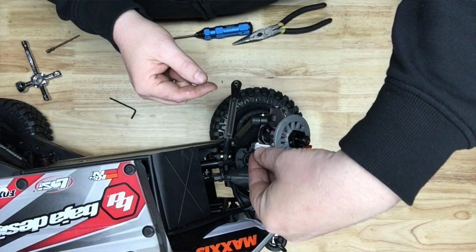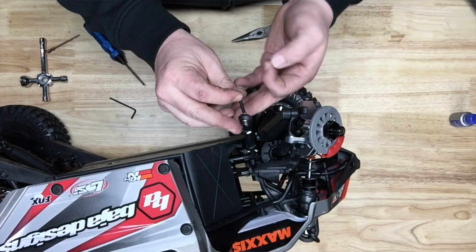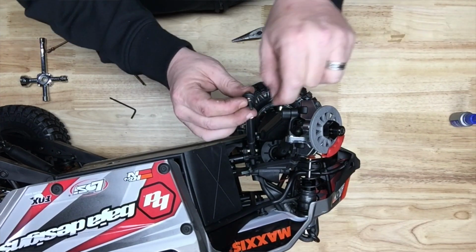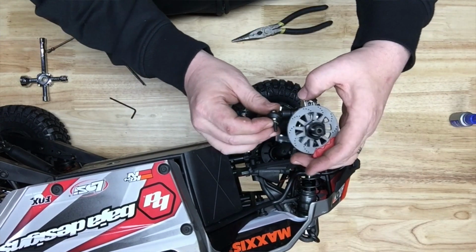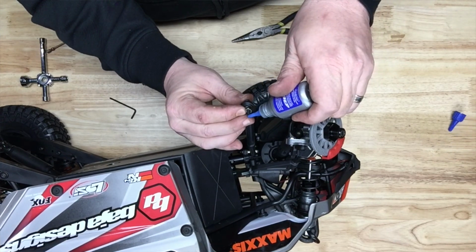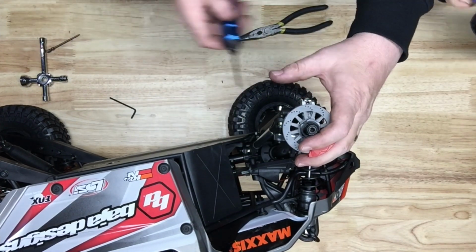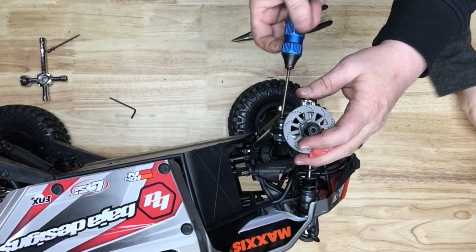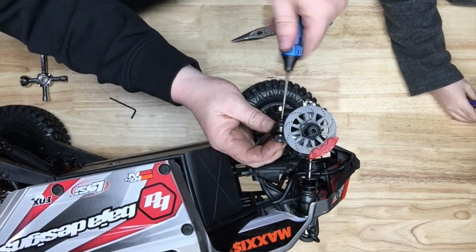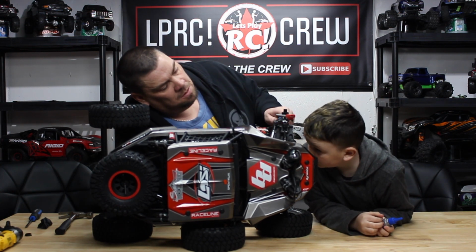The little nut that we pulled out of the old set, back in the top here. Steering link. Put your steering link screw. Now remember guys, this screw for here is just a little bit longer than the top A-arm screw. So then the little washer that came off, right? And of course going into aluminum, we're going to put a tiny bit of Loctite on there. Actually, I guess I didn't need to here because it's not actually going into aluminum. It's going into that lock nut. Sorry, guys. Loctite ain't going to hurt anything anyway. There we go.